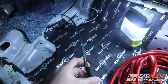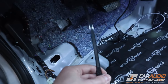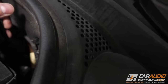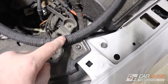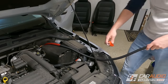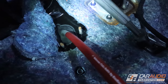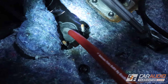To get the wire into the engine compartment I'm going to do the old zip tie trick. I've already got the grommet threaded onto the wire — make sure that you have it in the correct direction — and I can just poke this through that hole, then fish it out in the engine compartment and pull this up through. I pushed it up through and it was sitting right here when I came around to the engine compartment, so first try. Once I have the wire in the engine compartment I like to make sure it's well protected, so this meant wrapping it in wire loom and then wrapping it with exterior protection tape from JK Tapes. This gives a really strong, protected wire inside the compartment. I make sure that tape goes all the way back through the grommet — you can see that is a nice perfect firewall transition.